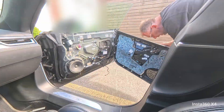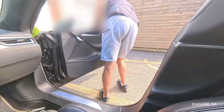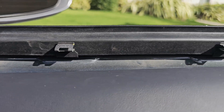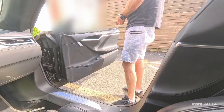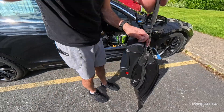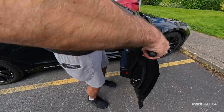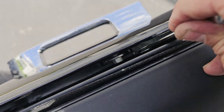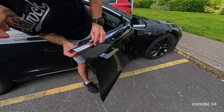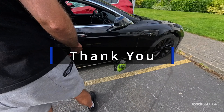Match connectors and connect all the electrical cables back together. Remember about the door opening lever cable. Make sure the stop piece with the window inner seal is aligned on the door before attaching the main door trim panel — this makes it way easier to put the door panel back on. Put the funny last top nut back in its place; a magnet holder, screwdriver, and flat 10mm did the job. Torque it properly. Put door panel screws back in and the window seal trim piece. Done. Success. Doors are working as they should again. Thank you for watching and see you next time.